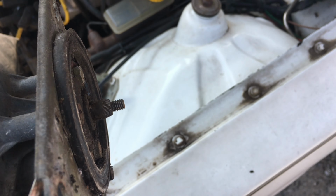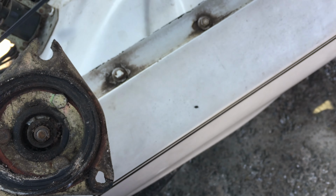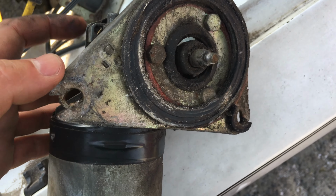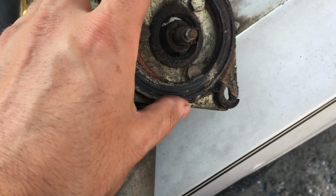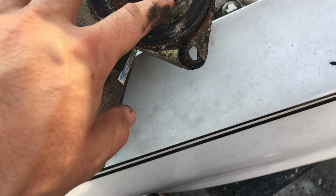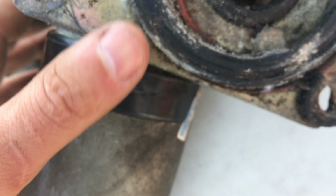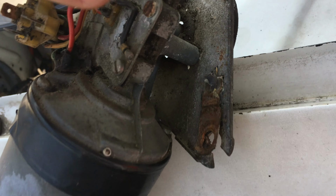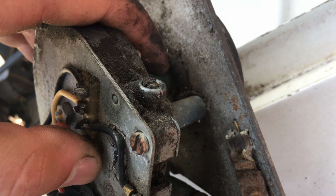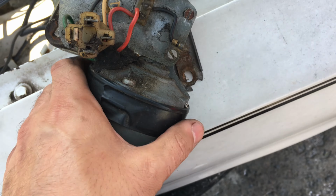Okay, so there used to be rubber grommets around where the bolts go, and that would also serve as a spacer so that you don't squash this gasket too much. But I'm thinking that there's a very bad design flaw, which is this hole here, because as you can see, water is going to pass through there and then into the car. So that's very strange.